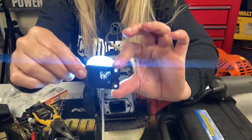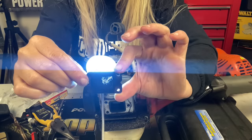Hopefully you can see that — about half of it is covered up with carbon buildup. I am going to replace the screen. Now if you're at home, you can hold it with your needle nose pliers and burn it with a lighter, or use a torch and scrape it off, or use some carburetor cleaner or brake cleaner to get it clean. I recommend putting it back in. I do work in a small engine shop where I can get fined $27,000 if I do not put a screen back in the machine, so I'm going to tell you: put that screen back in. I have a brand new screen here — the part number is 145-862-40630 if you want to replace yours. Set the machine on its side to work with gravity; it's a lot easier than trying to hold everything up.